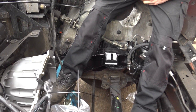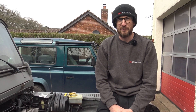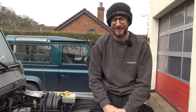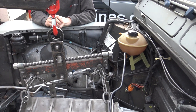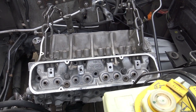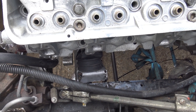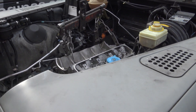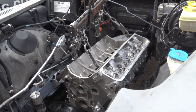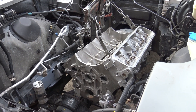Except Holly works faster than we can film, so hiding behind his leg there is an engine mount already in the right place. So we've got a dummy block in position. Holly has removed some engine mounts from a Range Rover Classic chassis so we know that the correct angle is right and we haven't got to spend any time fabricating anything there. We've hoisted the engine into position, obviously bolted up to the bell housing of the gearbox which is on its original mounting, so we know everything's in position. That just leaves Holly to weld these in place.